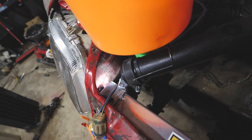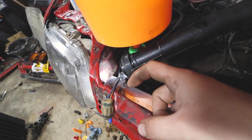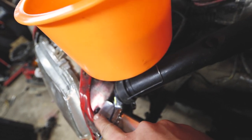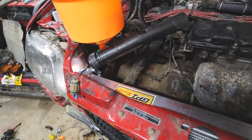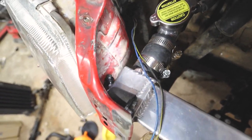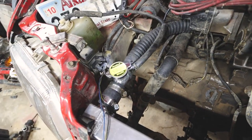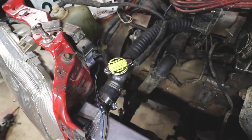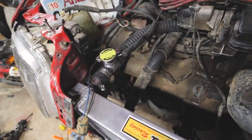I do have a tiny leak. There's a nipple there where the overflow reservoir is supposed to hook up, but since I have one built inline I plugged it — and when I was moving the radiator back I accidentally knocked a small hole in it. I'm going to pull it back and put a new nipple on there, trying not to dump all the fluid out. That actually wasn't the nightmare I thought it would be. I got it plugged back up, filled with coolant, and now I need to figure out the polarities on the fan switch to hook up my external fans.